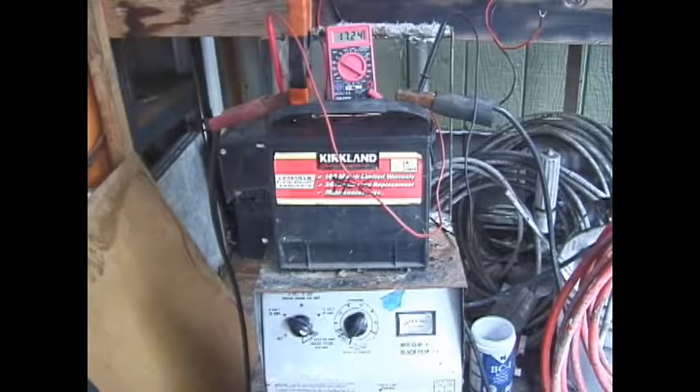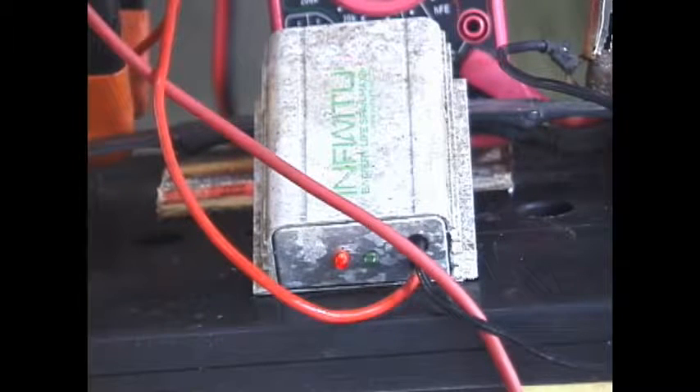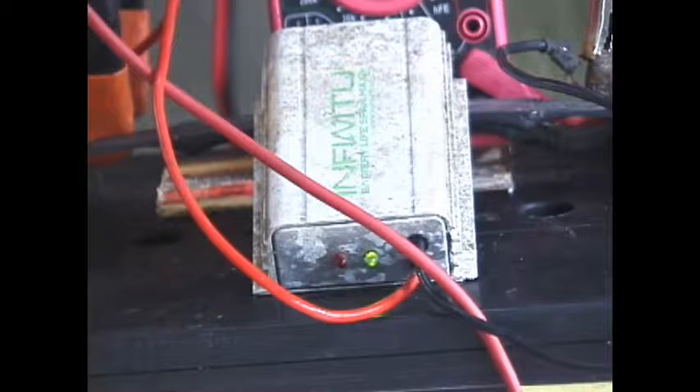Number 2: The battery can have chemical additives like the old VX6 or the modern Chargit or battery equalizer, which are products that have aluminum sulfate or cadmium sulfate in them to cause the sulfation to be removed. I have used alum or aluminum sulfate. Number 3: The last system for desulfation is using a high-frequency stimulator to remove sulfation from the batteries. Here you can see the Infinitum that I have — it's got a red LED light on it, and when the battery voltage gets up above 12, it turns to green, as you can see.